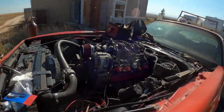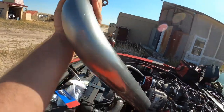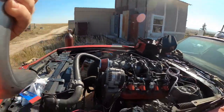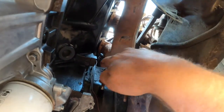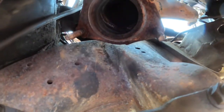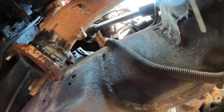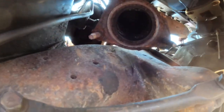I'm working on the exhaust today. I got the stock manifold in there, got the flange turned, and my first piece cut and welded to cross over underneath the bell housing. I cut the flange off the manifold, added a wedge on the outside edge, and rotated the flange so it would clear this portion of the subframe. You can see the wedge in there — that way everything clears on the subframe and gives me just enough room to come across.